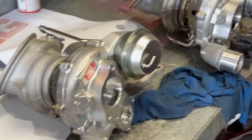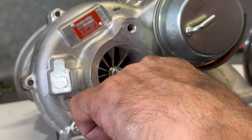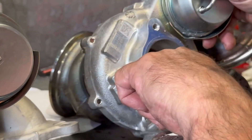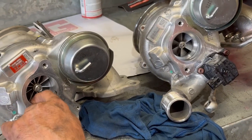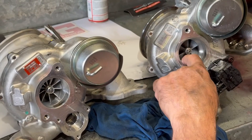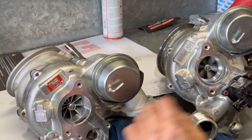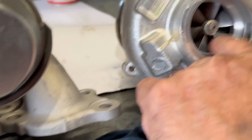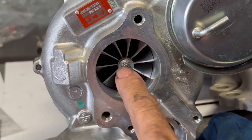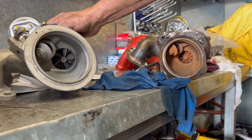About 50.5 roughly. You look inside there, you see the size of that wheel - see there's no step. Yeah, but there's a substantial increase; you can see that's the same diameter all the way through, almost. That one's got a massive step, so there's probably a good three to four mil increase in compressor wheel diameter. And that one's got more blades on it than this one - the factory standard. So that's the standard and that's the high-flowed upgrade.